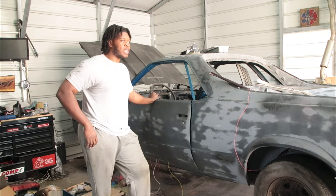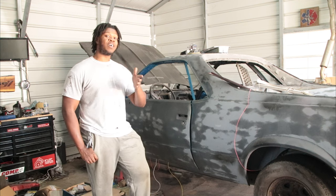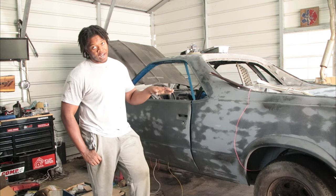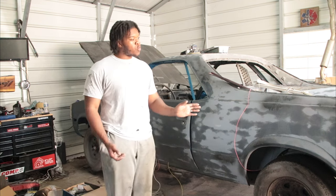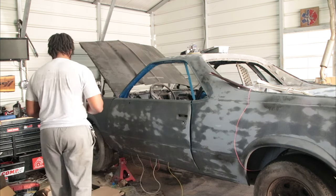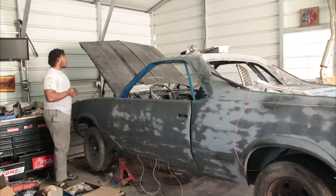Next up — if I had to redo the rear end, I think I may just go ahead and put an 88 up under it, if I'm being honest. I left the 7.5 up under it. I went with the 7.5 Yukon gear and axle, 3.73 gear ratio. I painted the frame, but as I was priming the car down I wasn't covering the frame, so I got to go back and spray it black. I did go ahead and go with UPR upper and lower tubular control arms — non-adjustable, just regular plain Jane. If I had to do it again, another thing I would have done was go ahead and go with the tubular control arms in the front as well.